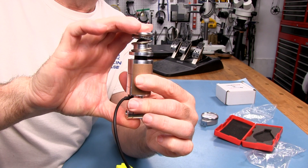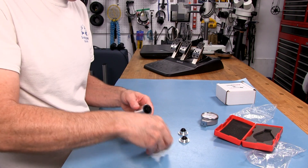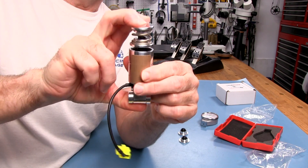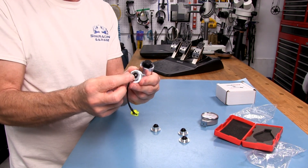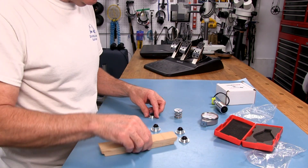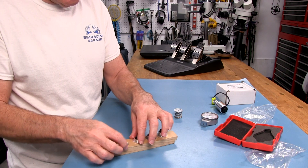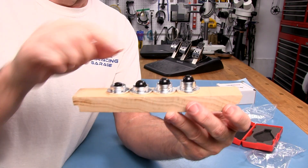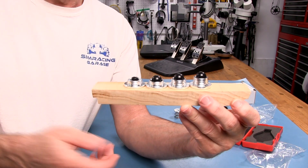With a larger bumper, you don't push very much before hitting it. With the smallest one, you can already see the gap — you can push a lot more before engagement. So you can adjust the feel. Even though all the urethane durometers are the same, there's a pretty good range of adjustment. You can see we have less preload here and maximum preload there, and we can adjust in between. All CNC machined — this is just a beautiful piece of kit.